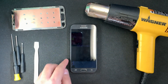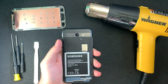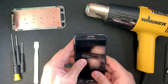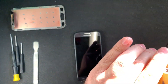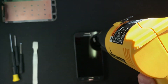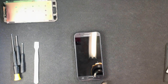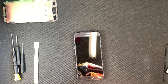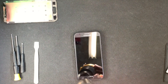What we're going to do is turn off the device and pull the back and the battery out so we can start with the replacement. You can use either a hairdryer or a heat gun — I'm going to be using a heat gun, but you want to set it on low, not too high, and keep it not too close to the screen so it won't melt or fry the LCD inside. Do that all around so the adhesive will come a little bit loose.